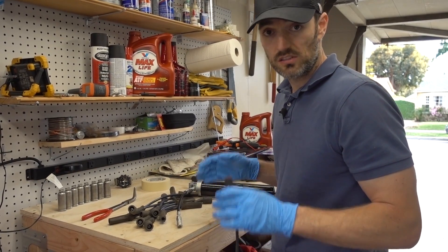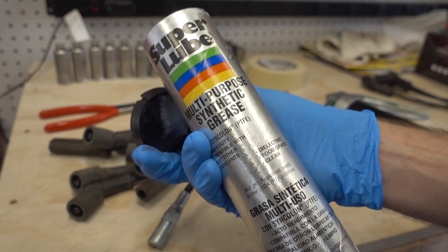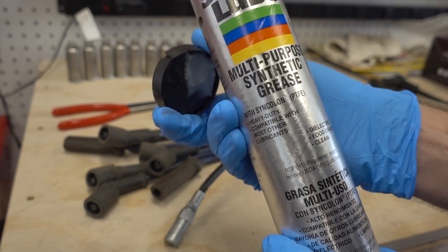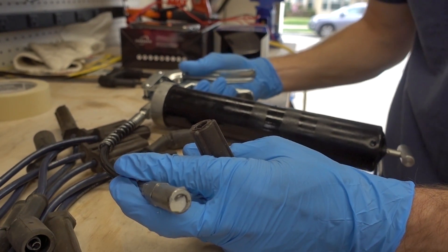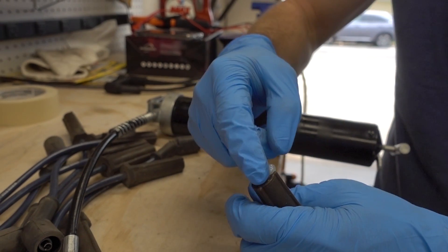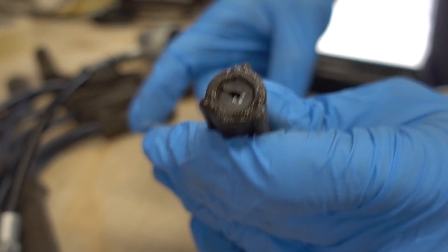The first thing I normally do when I install a new set of plug wires is apply some dielectric grease. The grease I usually use is this Super Lube — I really like this stuff, and it is dielectric. I'll link it in the description below. I have it loaded up in my grease gun and I'll just go ahead and squirt a little bit out, grab it with my finger, and put some all around the edges. There you can see the end is filled with grease, and that'll just get smeared around once the plug starts going in.